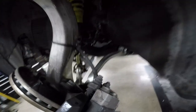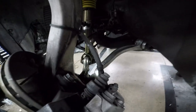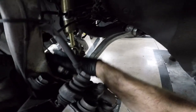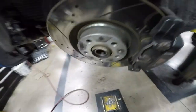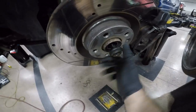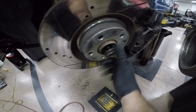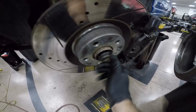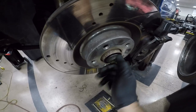The axle is out. Cleaned up as much grease as I could — I'll do a good power wash later. I'm going to take the stub axle, put them in there, take our bolt, just thread her in until it stops, and then we can torque it once the wheels are on the ground.